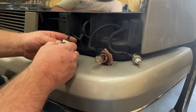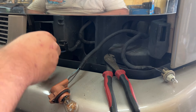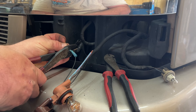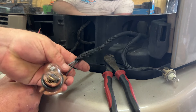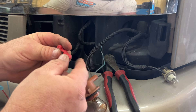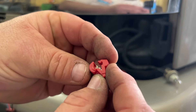But this socket here we're going to cut off — it has a black and a blue wire. I'm going to go ahead and cut it off. I'm going to connect this black wire to the black wire of the new 3157 socket. This next pink wire is going to go to the brown wire of this connector — that's going to be our park light wire. This right here is a back-tap, or some people call them different things. Basically it goes around and crimps the wire, and once it crimps the wire, you can insert a male connector on the other end of the wire into there and kind of piggyback off of it.